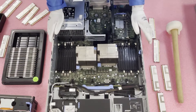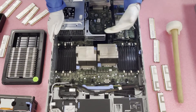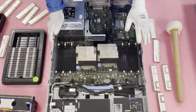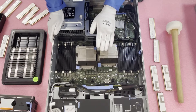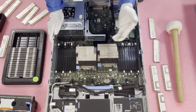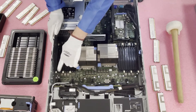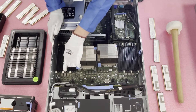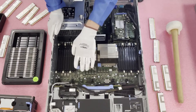That's a crucial feature moving forward in future generations: when you can use load-reduced memory, it breaks the rank rule — and that's the technology we recommend for 12th gen and newer machines. If you are doing 32GB DIMMs and putting in 12 of them to max out at 384GB, the best way is to start at the beginning of the channels: fill white, then the first black, then skip the second black — which is the third slot of the channel. Repeat this pattern: white, black, skip third black — for each CPU side.